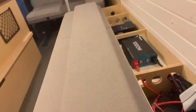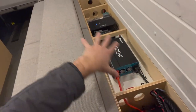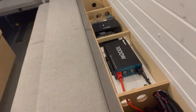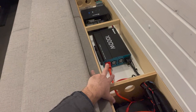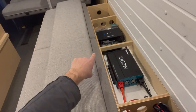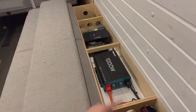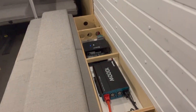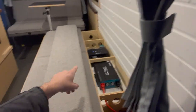Here's the electrics. You've got tons of space here to hold all the electrics, which really frees everything up for storage. There's a large 100-amp-hour battery, the inverter — which can be upgraded — comes standard with a charge controller that can charge from the engine while driving. You can also add solar on the same unit, and it has shore power standard. There's also space for an extra battery, and it's got tons of airflow all the way through to keep it nice and cool.